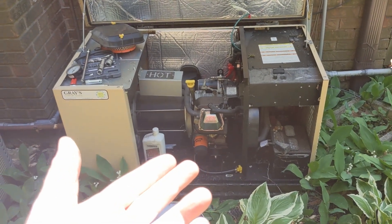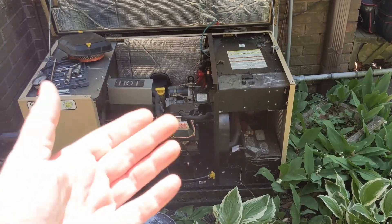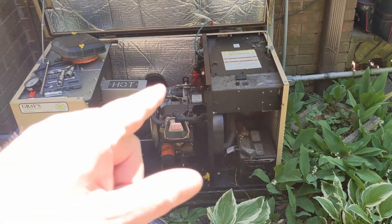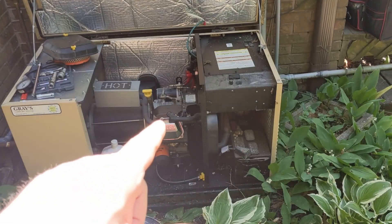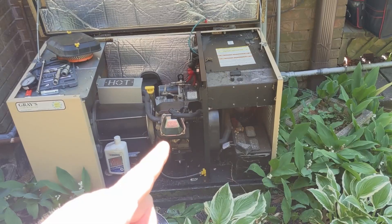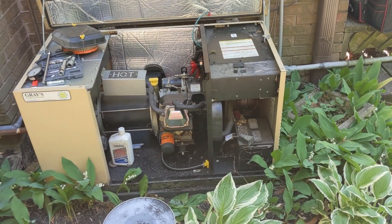It looks like it's going to be a short video. I'm not going to show you the repair on this because low compression on this engine means the rings are probably bad, which means this engine needs an overhaul. The work to re-ring is fairly straightforward on a small engine like this. The problem is it's attached to all of this, so getting it out is a lot of work — probably at least a day of effort getting this thing apart just so I can rebuild it. That's definitely not happening today. Thanks for watching.